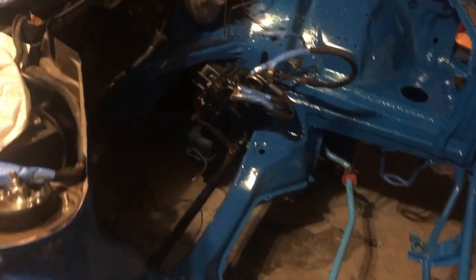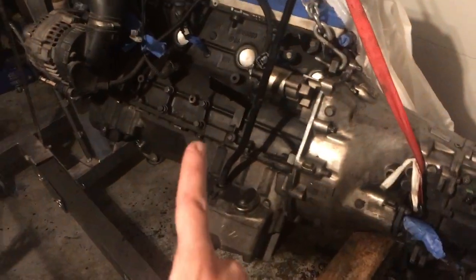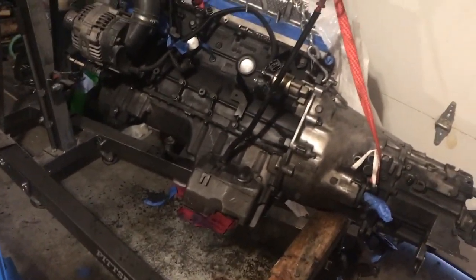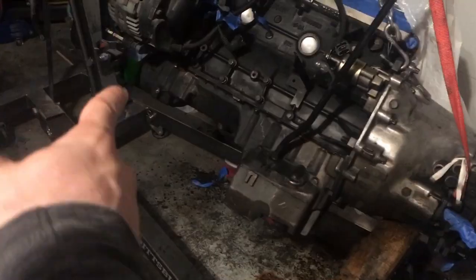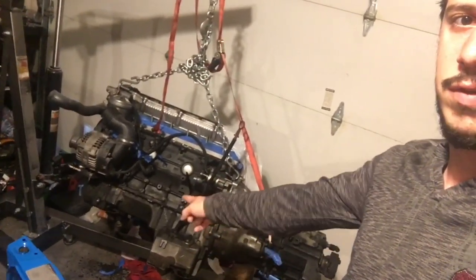The main important issue I see right off the bat is the steering box. I don't want to remove the steering box, but the sump on the M50B25 on the E36s or the 328 is in the rear — we need the front-sump oil pan. You can find that oil pan off of an E34 525i, from 1991 to 1995. Those cars come with the same exact engine except the oil sump is in the front. That's a common thing they use on E30 swaps. Just know right off the bat it's going to be a bit pricey and hard to find.